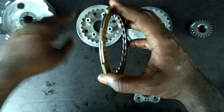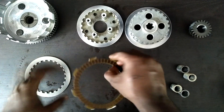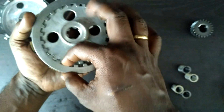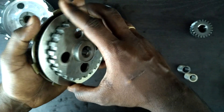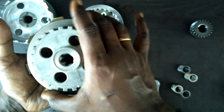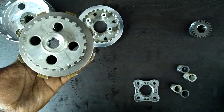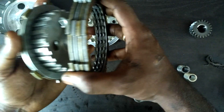So how are these components arranged? First we have to place the clutch plate, followed by the steel plate. If you notice, the hub has grooves in them and the steel plate has protrusions which match the grooves. So the clutch hub and the steel plate always rotate together. If you see, the clutch plate is actually free — the clutch plate is not connected to the hub.